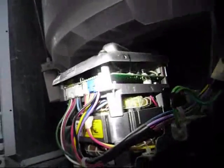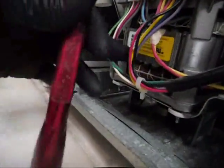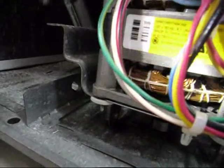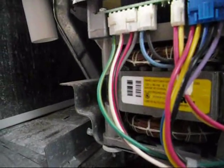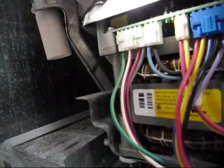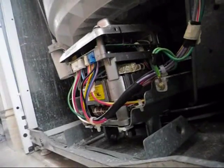It's funny how it runs slowly and all of a sudden the computer tells it to start draining — all this crappy electronics. Made in China. The motor is made in China. Electronically protected, use enclosed washer only. Exposed terminals, PC board, and rotating parts may cause injury or electrical shock. Disconnect power and allow at least five minutes for capacitors to discharge. So any minute it's going to start draining. I thought maybe one of these hoses had a busted clamp or split. Nope — the main drive seal.